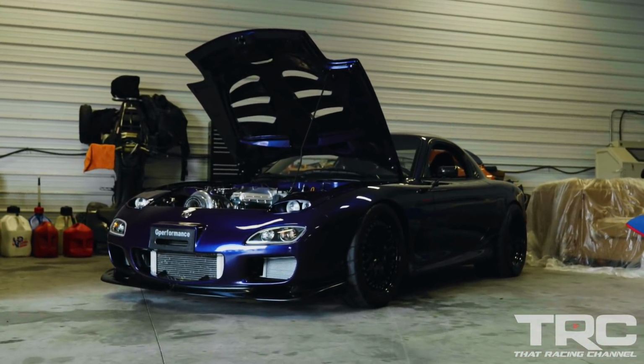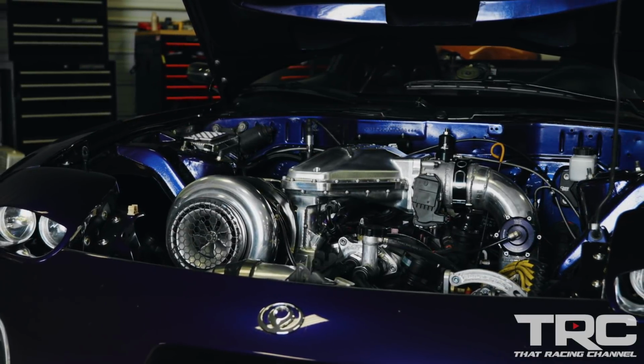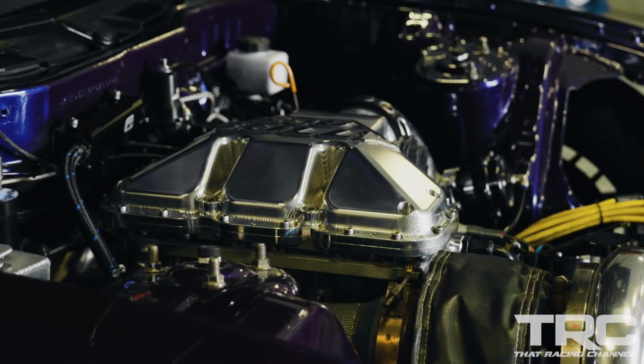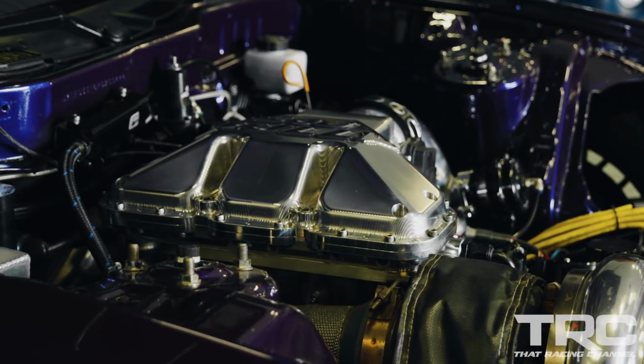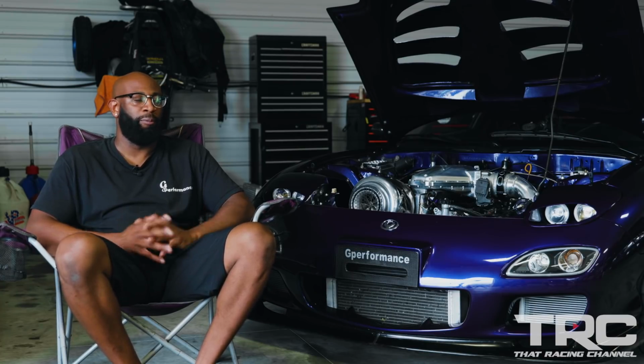Name is Tajh. I got a '93 Mazda RX-7 R1. So for the engine, it's a 20B. It's a C series, so it's already pinned. I do have upgraded dowels and everything in it. It's large street port. The rotor's been scalloped. RX parts Apex seals, and then OEM seals for everything else, pretty much. So it's a pretty simple build with the car.